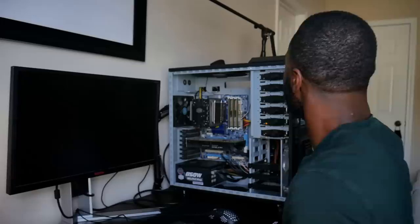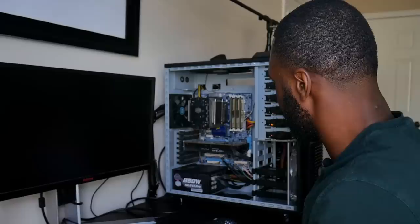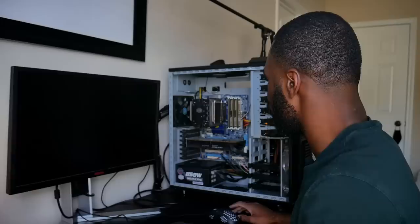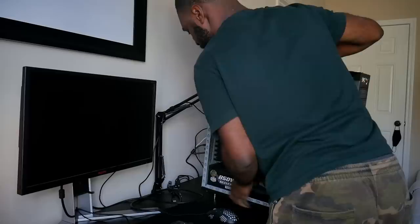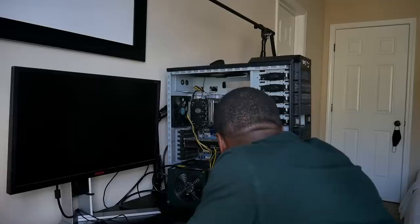Let's see if Lazarus actually turns on. That's not good. I kind of had a feeling that this would happen. So I started with the obvious — the power supply. Maybe it was dead or there was a short with one of the modular cables. I tried an Antec 650 watt unit that I knew was working, and nothing. So my mind immediately went to one of the less than pleasant cases: the motherboard.